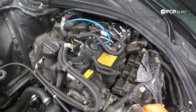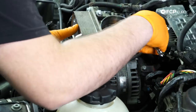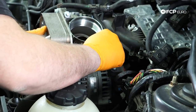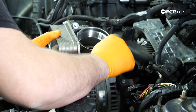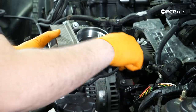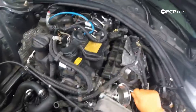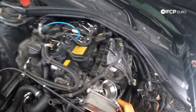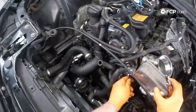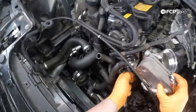I like to get these started by hand first. About the worst thing you could ever do is cross-thread one of these bolts. So just be careful and make sure these bolts get started. The key to doing this job is definitely fiddling with that lower bolt. So you don't want to thread these bolts in too far by hand. You want to give yourself some wiggle room so you can start threading this lower bolt in